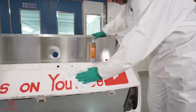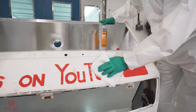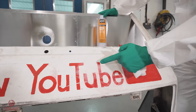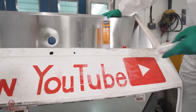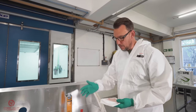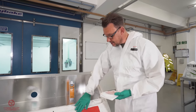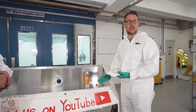We're quite fortunate there's not a massive amount of painted bodywork on it. It's not overpainted. So as you can see, the paintwork is going quite soft. See how I'm moving that with my nail? If we'd sanded that top area and then painted Raptor on top, that would go soft and it would cause a wrinkling effect. So the Raptor will wrinkle, it'll look like mud cracking. So what we need to do is give it a clean first, get the DA sander on there and take all of this household white paint off. Perfect. Okay, and then we've got a sound substrate to paint on.